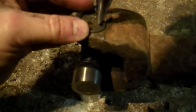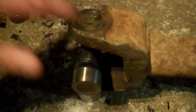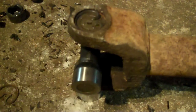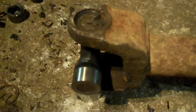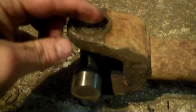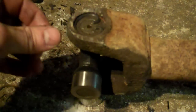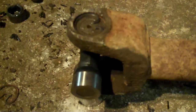Squeeze your pliers and release it. Now that cap right there — you'll keep tapping it in. They don't always go in easy, and honestly that's a good sign. My rear driveshaft went in a bit too easily, which kind of scares me — I like that interference fit because it means the U-joint is not going to slide anywhere. You may have to put your extension or socket on here and tap it a few more times to get that ring fully seated inside the groove.